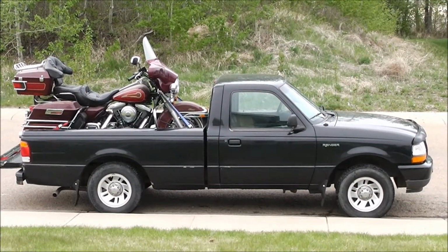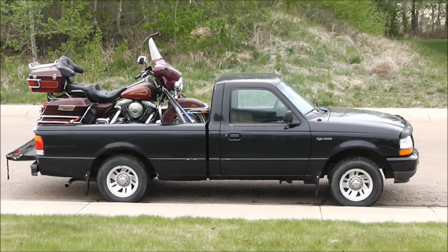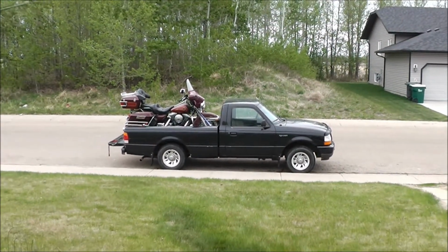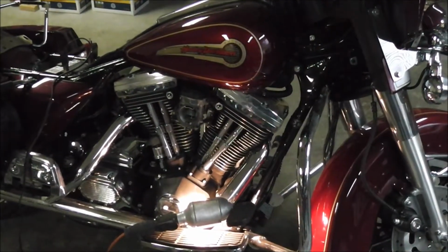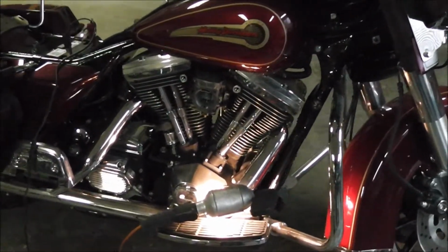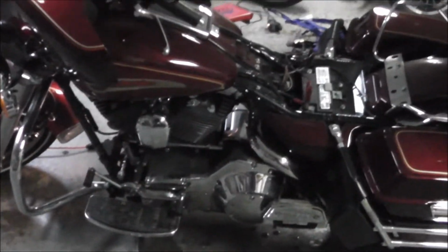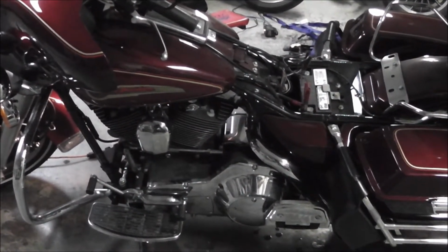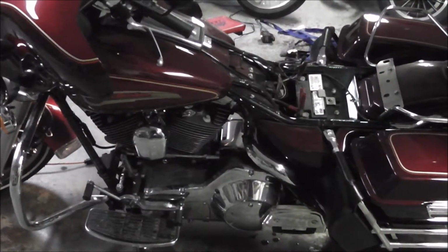We made her. Okay, got her home. Drained all the fuel out of her. It's got the VOS system, vacuum operated switch, for the petcock, so I put a slight vacuum on there, just enough to get it open. Drained all the fuel out of her.